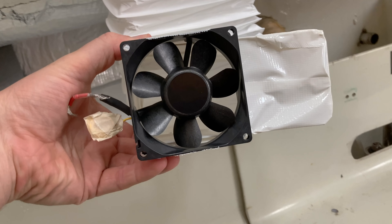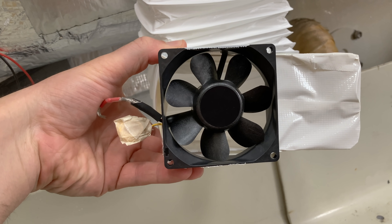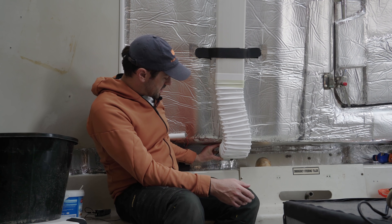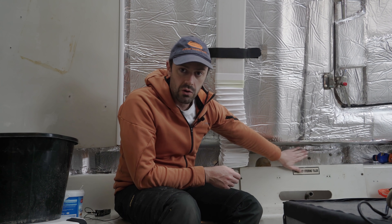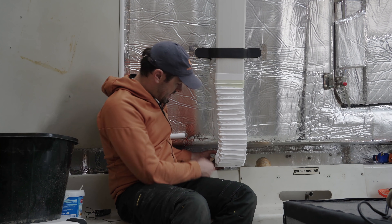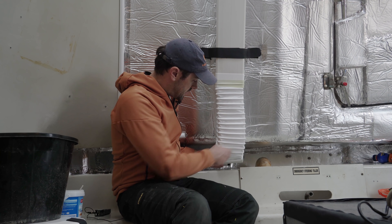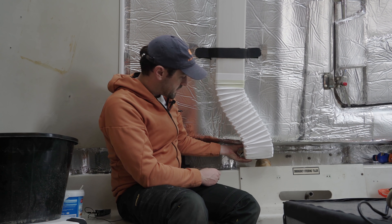It's worth saying there will be two fans in the end, but I've only got one at the moment, so that's why I've blanked off the other area — it means they can both share the load. I've got two options really. The first is a simple option: fit it either on the top or on the bottom, then glass around and insulate a little wall along there so that when there's a panel across, the entire thing is sealed and air is drawn up from only the engine bay. That's straightforward, but I lose a little bit of storage cubbyhole and the wall shape gets quite complicated. Another option is to move it all the way over and put it into the panel that's going to be removable, then put a wall straight up and have the maximum amount of cubbyhole for storage.